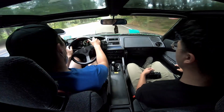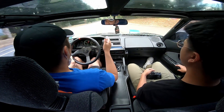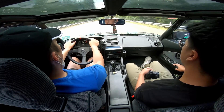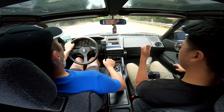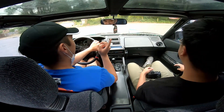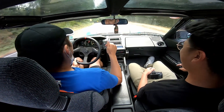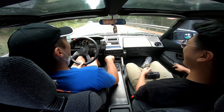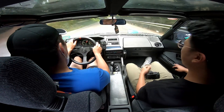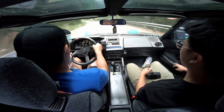This also doesn't have power steering. Even though all the bushings are brand new, there's still some take-up — it's not play, it's just like an older car feel. Same with the CRX I test drove. Overall the suspension upgrades feel great. As for alignment: zero toe up front, negative one camber front, negative two camber rear, and point-two rear toe-in. That keeps the rear planted and in line. It's kind of like my MRS setup but a little more mild for street use.